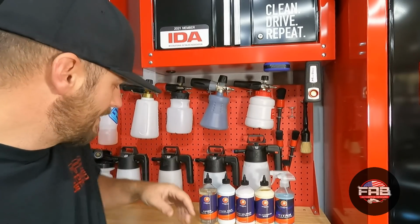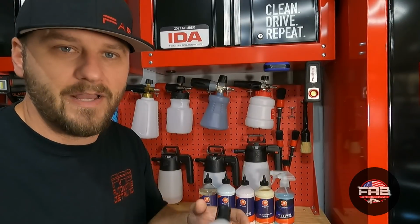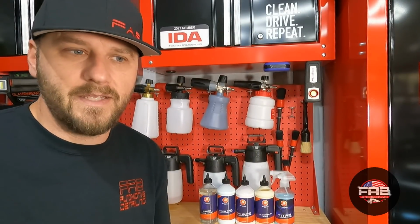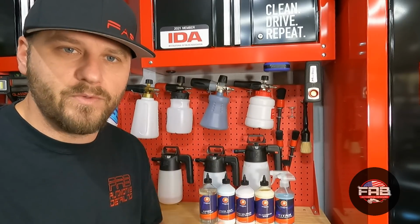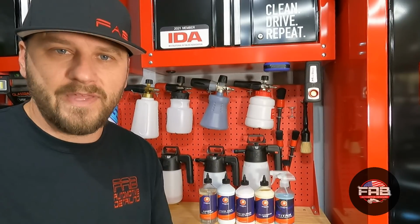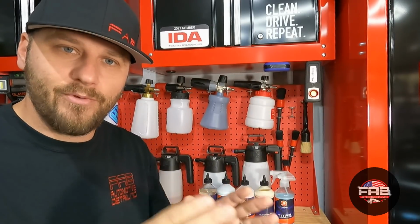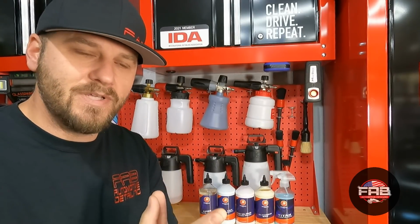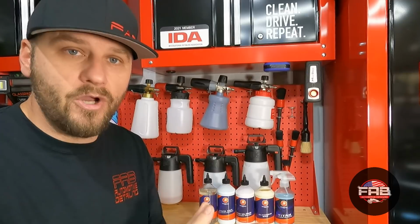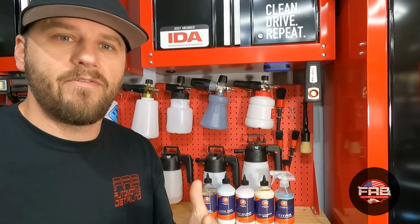You know, he sent us some samples, and I'll show you. This is the very first sample I got of the FAB-ulous Finishing Polish right here, and I got several of those behind me. He sent us samples, and there were ones that I hated, there were ones that I liked, and we kind of mixed some together to come up with the final result on mine. And I think mine took the longest because I did a lot of testing on it. I made sure that mine would remove 3,000 grit sanding marks on the paint, and I also wanted to make sure that you could see through the polish as you were using it, so you can see the cut you're getting, the finish that you're getting, so you don't continue to go and go and go and remove more clear coat than you absolutely need to. So that's what you're going to get out of the FAB-ulous Finishing Polish.